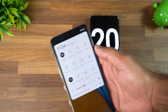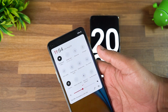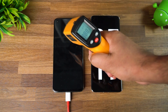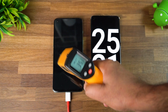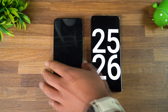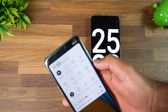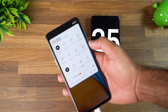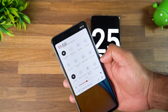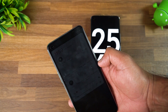Next let's measure at around 30 minutes, or if it reaches 100% before that, we'll wait. Right now we are at 25 minutes of charging. A quick look at the temperature — 35 degrees, so again no significant temperature rise. At 25 minutes, almost 96% is completed — very impressive performance, 96% in just 25 minutes. Next, let's see how long it takes to complete the remaining 4%.